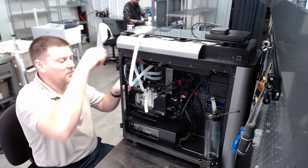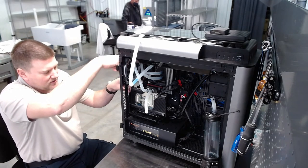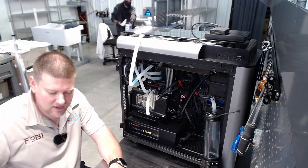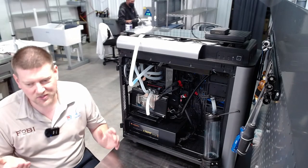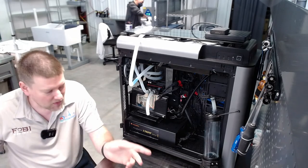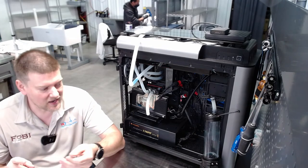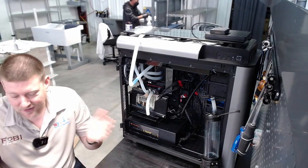Things like thermal pads and thermal paste do dry out after just a few years. But say you've got workstations for your monitoring system. You'll vacuum them out, but you don't change out the thermal paste or anything. Then you start getting errors or black screens or they lock up, and you just say, oh, it's because the computer's old. You don't realize that, as long as the capacitors on the motherboard and the power supply are good, usually the problems are because it's getting too hot. Thermal pads and thermal grease have a life expectancy, guys. And that's unfortunate.